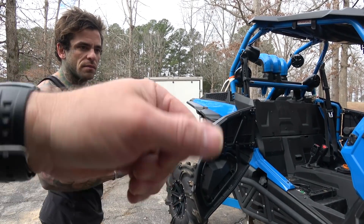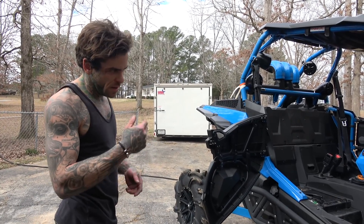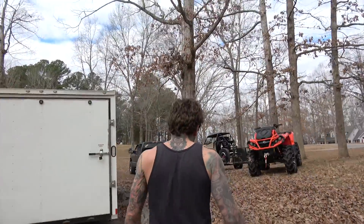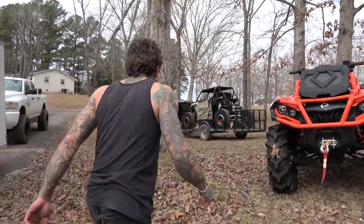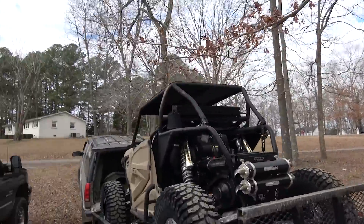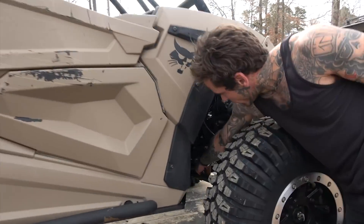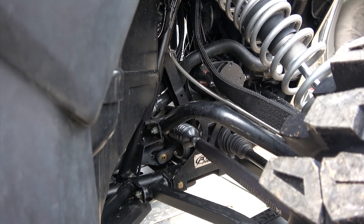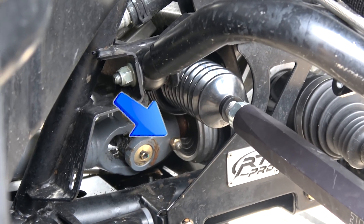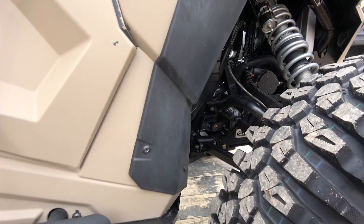You can tighten it down — just use a nylock nut. See how his has got a bolt and a lock nut? So don't use that roll pin anymore. It's a 10mm bolt — you can look it up on the internet. That's where the carrier bearing is, right? You've got to get all this apart to get that piece out of there.